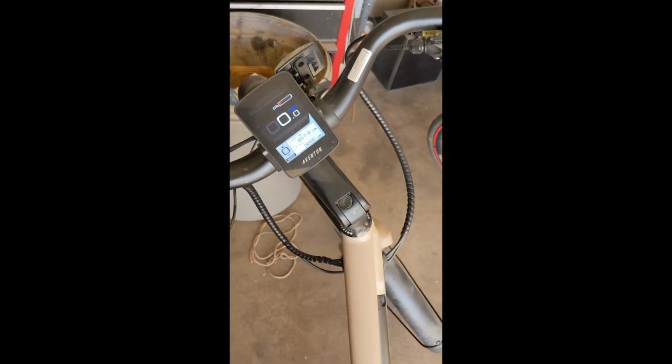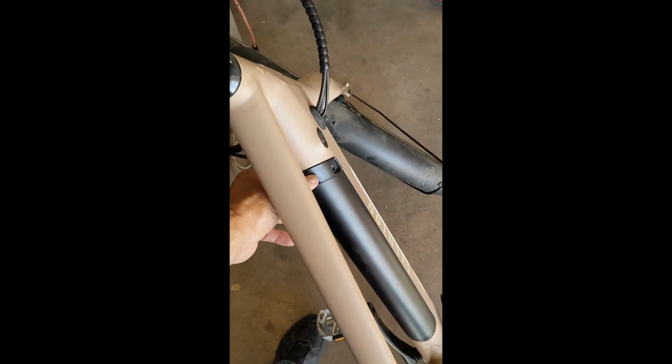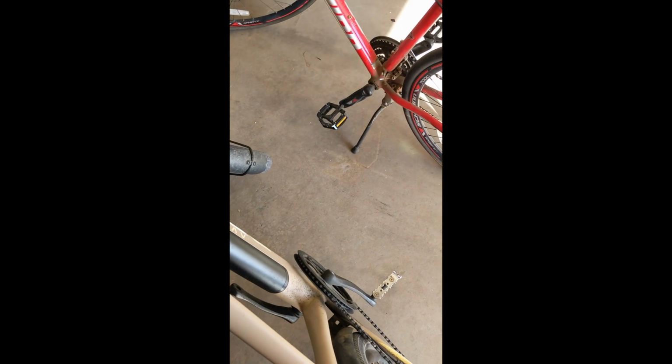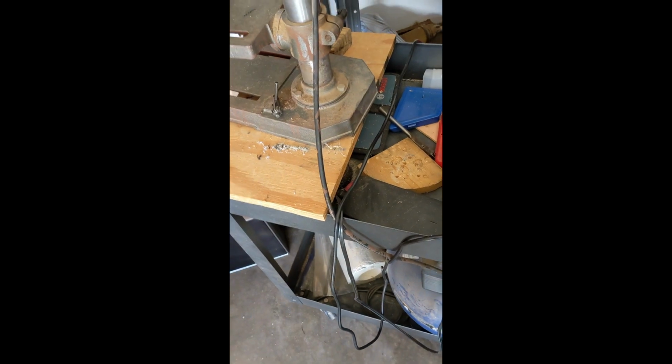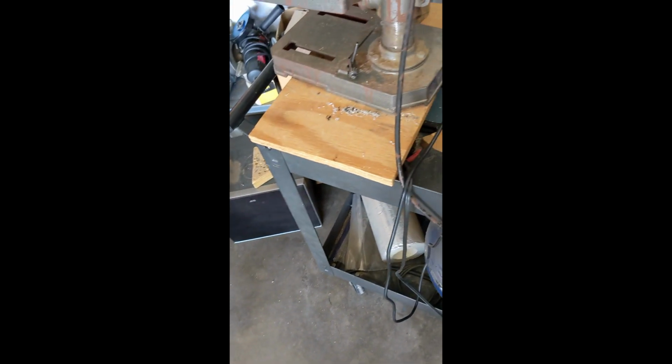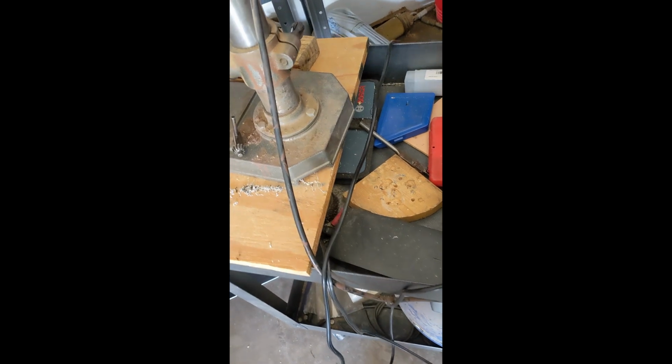I mean, these are just brake lights, hydraulic cable and shift cable. Nothing there. So anyway, no joy. I can shut it off anyway. Battery shuts off. That's all there is. Okay, it said 0%. And it read fully charged earlier today, and I haven't ridden it. So unless it's bleeding off inside, I can't believe it wouldn't get really hot if it had an internal short. So it's something in the communication or the battery itself or something that's screwed up.